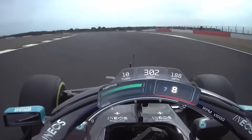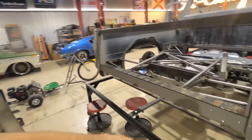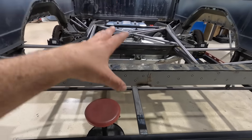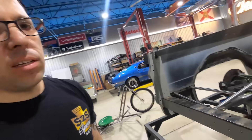I'm going to be working on the diffuser. A rear diffuser is actually going to help this electric truck with range and with aerodynamics as far as cornering and downforce. You have all the air going underneath the vehicle and it actually gets pinched at the back right where it expands and just releases. On the back of the truck we're going to fill in this whole negative space with diffuser, fins, and all that good stuff to bring the back end down and create more traction, especially at speed - 80 miles an hour and plus, that's when you'll start seeing downforce.